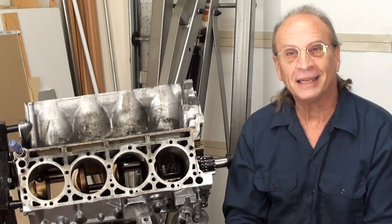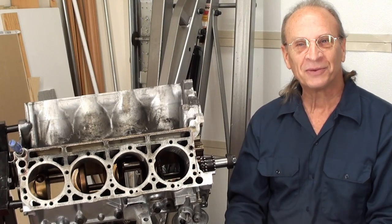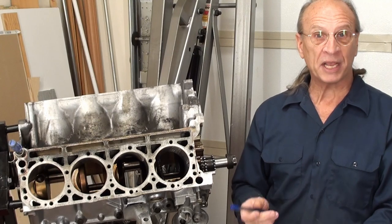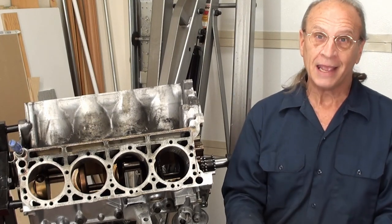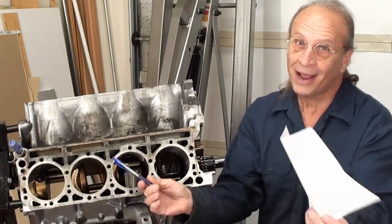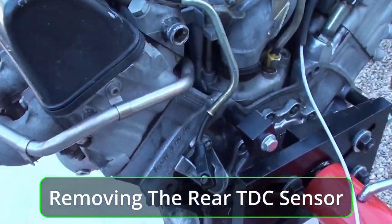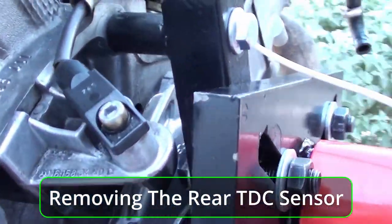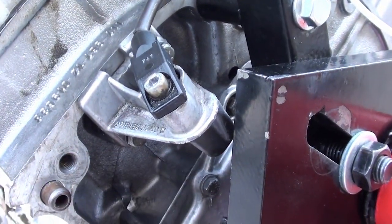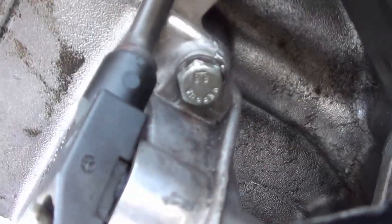You'll see at the end why. I'm still in good spirits — I promised everybody in 2022 I would be in good spirits. This video actually picks up on the very day that I pulled the engine. I just wanted to touch base on this top dead center sensor so you can see how close it is to the stand and all that. I actually removed it already and just didn't get it on film. I just wanted to let you know it's just a 10 millimeter and it's just a bracket.